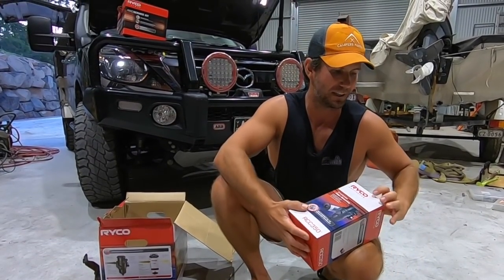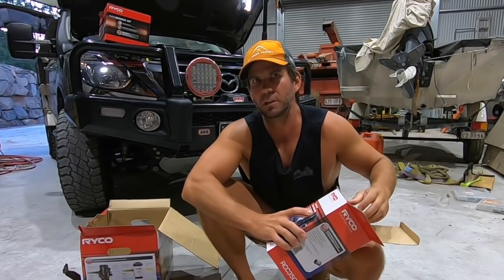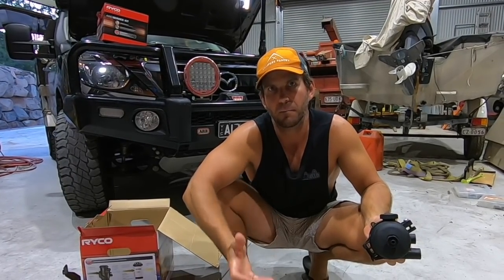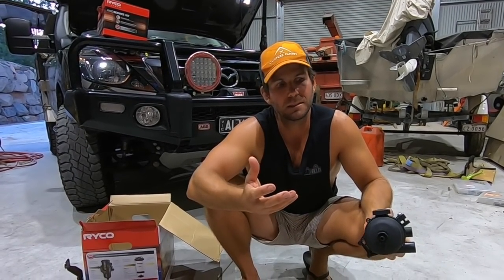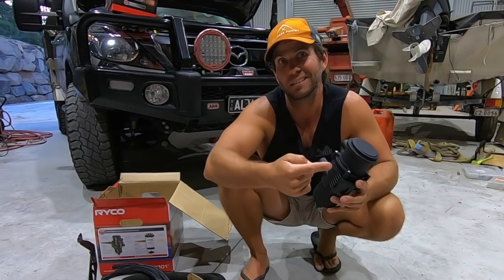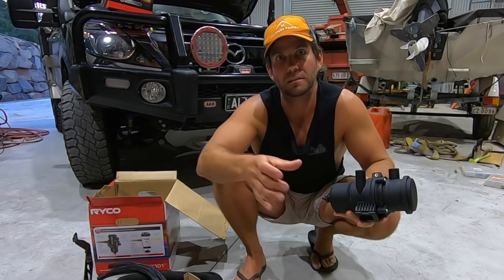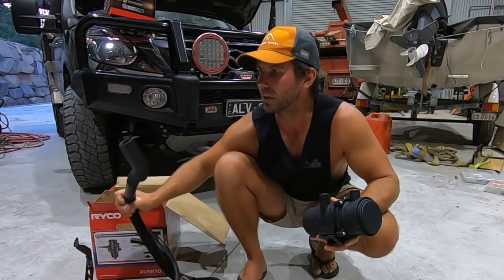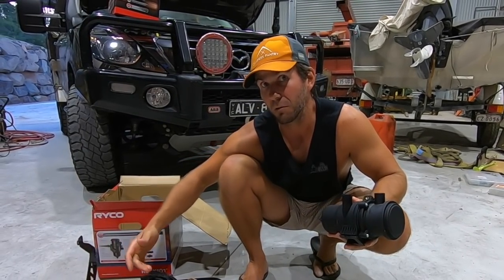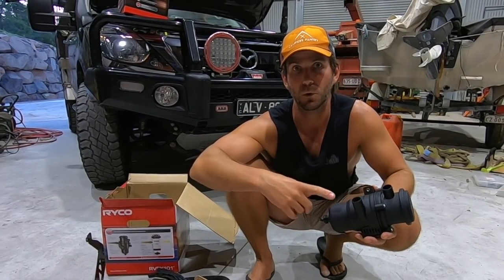Anyway, the crankcase assembly. This one catches all the blow-by. During the combustion process in your engine, you get oily mist and vapor coming up past the piston rings, and it goes into the top of your engine. Normally it just gets vented straight back into the intake for emission standards. You used to see trucks and buses with a bit of hose like this hanging out the back, pumping steam or oily mist out. That's the blow-by. But now with emission standards, it needs to be caught.